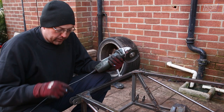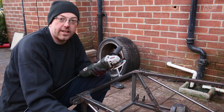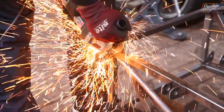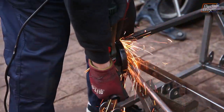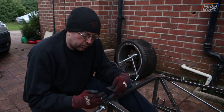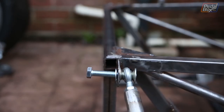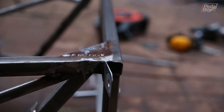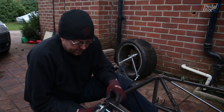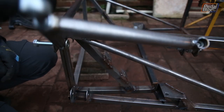Now we've got it back on the ground again, we're going to take this back bracket off so that we can bend the front one round and then do the same on the other side, so we can line them up so that they fit into the rear brackets properly. We've just tweaked this bracket backwards a little bit from where it was so it's in line with the front of the chassis now. Originally it swept forwards ever so slightly, which was giving the interference on our suspension arm. So the rear bracket, now we've cleaned it up, fits on the back of here nicely. We can weld that back in — we've got all of our washers in the back, everything fits nicely, and the arm moves as it should.